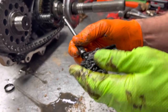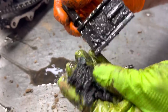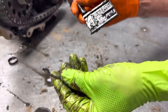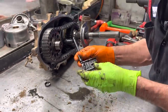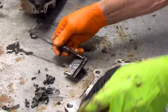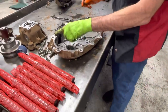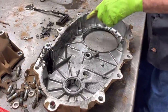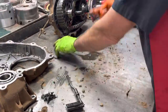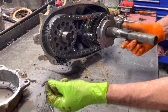Now guys, we talk about overkill on silicone — every bit of that is silicone. We've got a little plastic piece right here that looks like part of the shift fork insert. It looks like this thing plugged up with silicone. That's why when you silicone these case halves back together, it doesn't take but a film. Look how much they got on this thing — it's just oozing everywhere. What happened is it plugged up the suction on the pump, probably took out the shift forks in here, and that's where we're seeing our shift fork pieces.